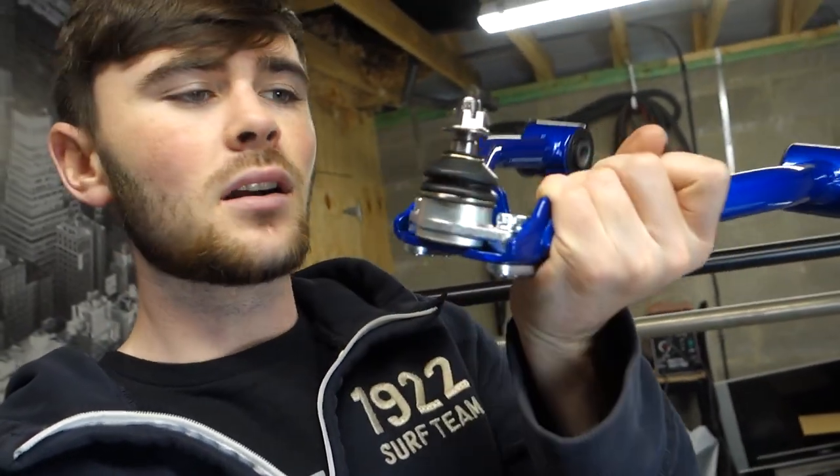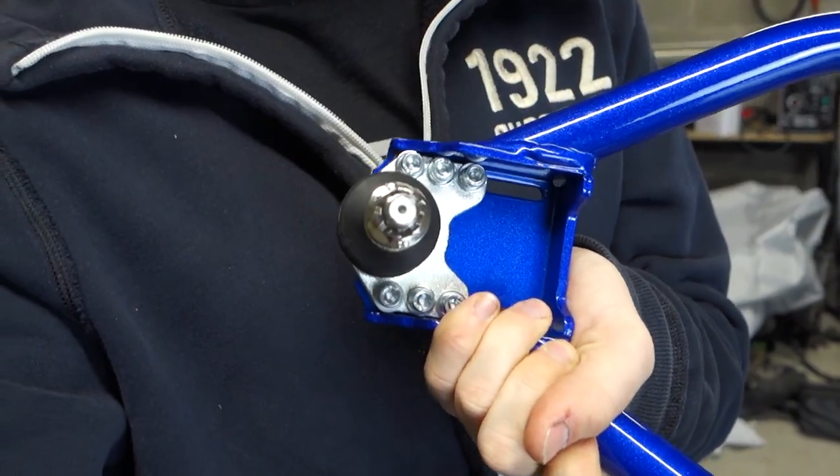Welcome back to another video on the lifted MX-5. Today I'm working on the car and fixing that positive camber up front for the final last time — hopefully. I tried to fix it before by replacing the alignment bolts. They weren't completely shot and I did fix it a fair bit, as it was dreadful before and undrivable. You would actually hear the tyres screech as you go along. When you lift these MX-5s, it's a known thing — you either have to get extended lower ball joints or adjustable upper control arms, so you can adjust the camber by adjusting these.